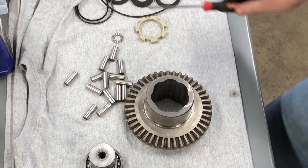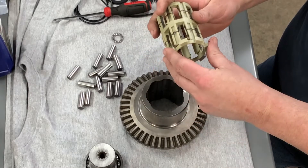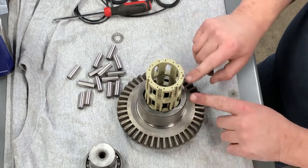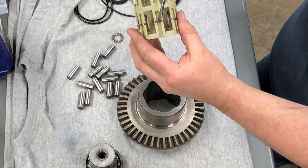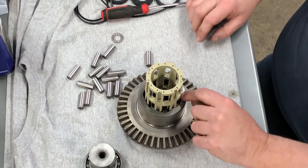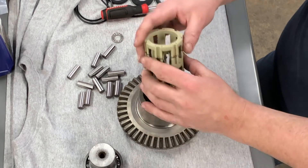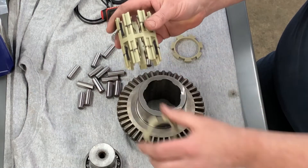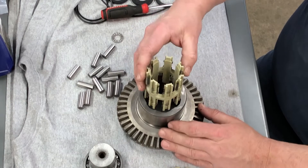Let me try to explain this. First thing before I start is the ring gear, the hub, and here's the new cage — top and bottom for the cage. Just real quick when you're putting this together: you could put this in, start the rollers, hold them in place, and force it down, but what happens is the little bridge on the H-clip sticks out and that little bit of protrusion stops you right there. You'd have to go around trying to push them in — it's really flimsy and you could damage or bend them easily. You don't want to do that. So an easier way is to take the top and bottom of the cage off, drop it down in there, and put the protrusions — those bridges — in the widest part where the rollers will ride, and just drop it in.